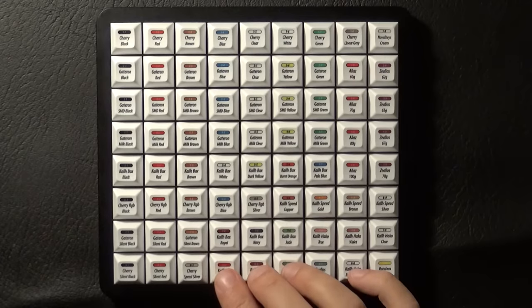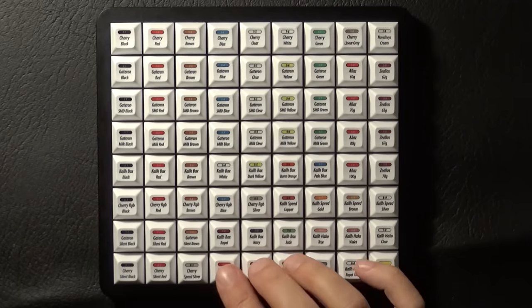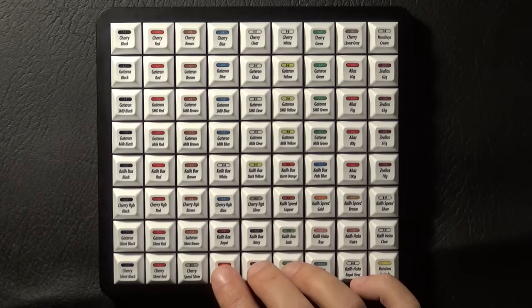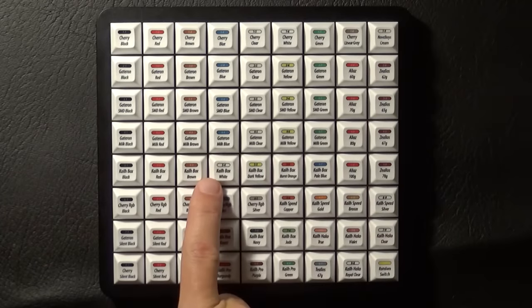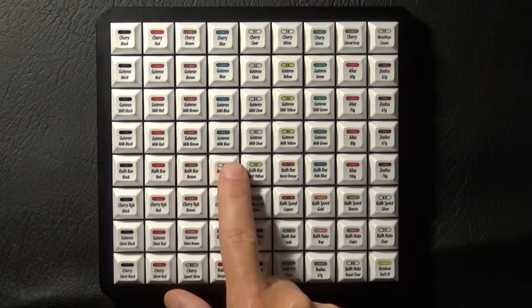All of these have an actuation point of 1.7 millimeters. So, quite a low actuation point. Responsive and quick trigger. So yeah, the low actuation point means it's a quick trigger. The linear one, they all have 50 grams in actuation force, but it's one linear, one tactile, one clicky. The clicky one with 50 grams, I can compare to Kailh Box White, I would have loved to compare it with, because it also should have been 50 grams.